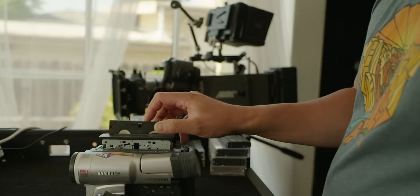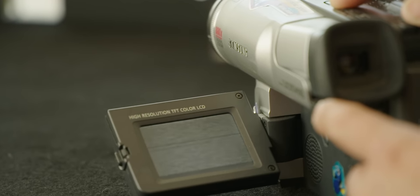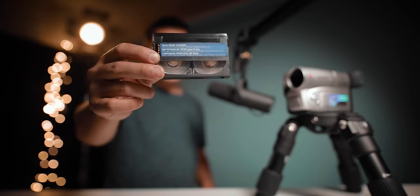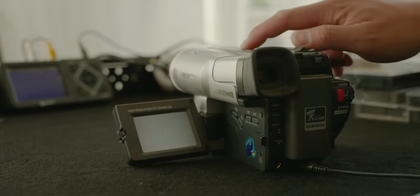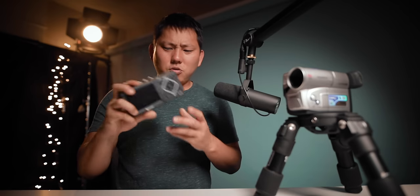The first thing I did when I saw this camera was pop in a couple of tapes to see if there was any footage remaining. It was just a fuzzy white screen. I was kind of bummed, but then I remembered you're supposed to run a head cleaner through these cameras. I found one on eBay, ran it through for about 30 seconds, and then suddenly the camera started working — all the tapes had footage still there.